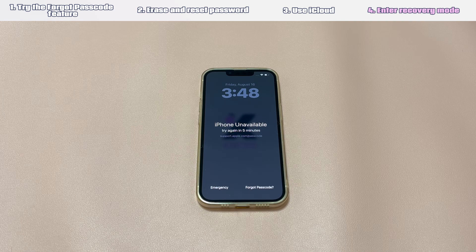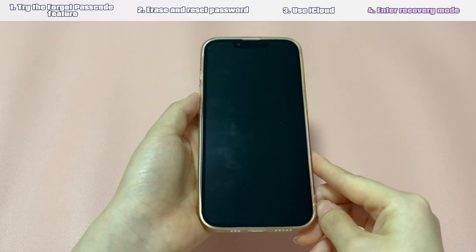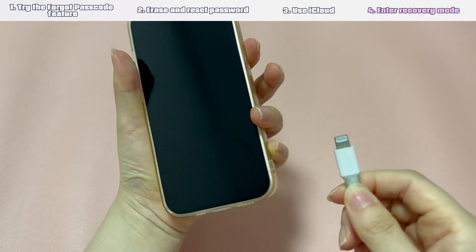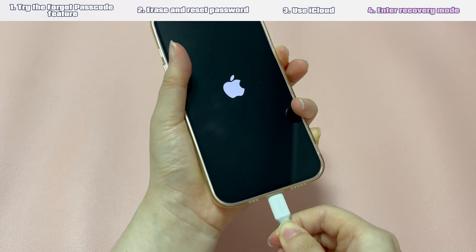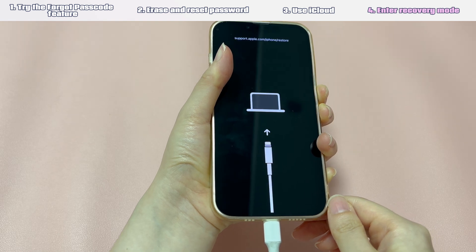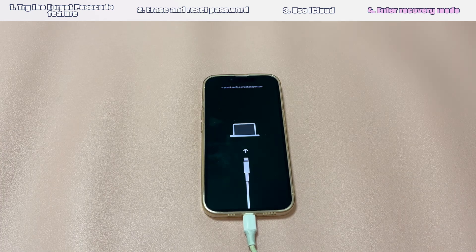On a Mac or a PC, download and install the Apple Devices app, iTunes, or Finder tool. Then press the buttons and move the power off slider to shut down your iPhone. Wait at least 15 seconds and connect one side of the USB cable to the computer. Then press the specific button and connect the other side of the USB cable to the iPhone. If you use iPhone 8 or later models, keep pressing the side button. If you use iPhone 7, keep pressing the volume down button. If you use iPhone 6s or earlier models, keep pressing the home button. Still keep pressing the button even when you see the Apple logo showing up. Release the button when the recovery mode screen appears, showing a computer, a cord, and a link.